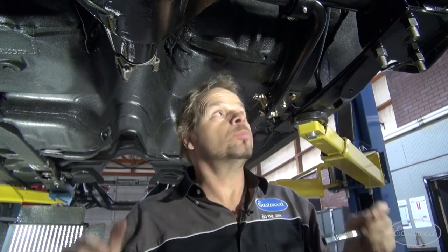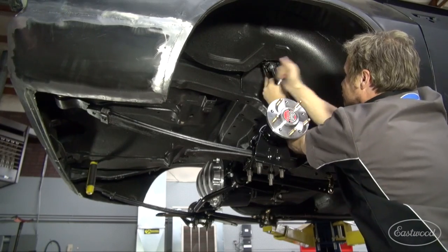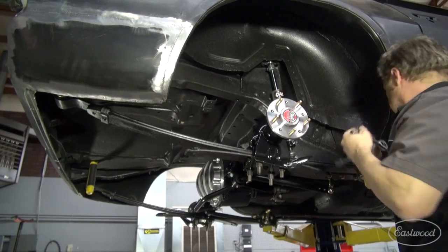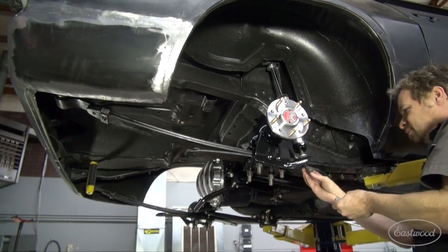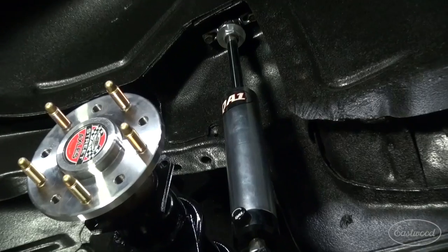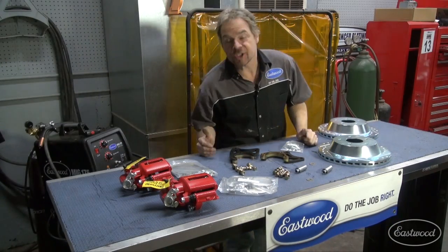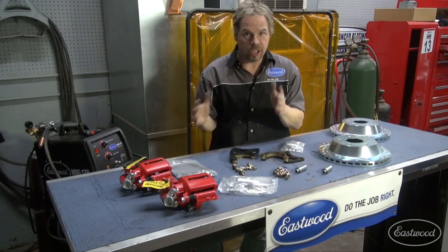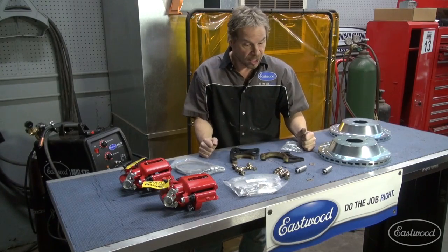We're going to leave things kind of loose until we have vehicle weight on the chassis — when everything's loaded, that's when you tighten things up. We'll make sure it doesn't fall off, but we've got to get to the last project: disc brake conversion. The QA1 single-adjustable shocks are part of the Classic Performance Pro Touring Stage 3 system used on Zed Sled front and rear. We can change the valve settings on these shocks easily and tune the suspension on the fly at an autocross or track event. The rear disc brake package is awesome: 12-inch rotors, all the brackets and shims needed to properly center the calipers, a brake line mounting kit, brake hoses, and single-piston calipers on the back.